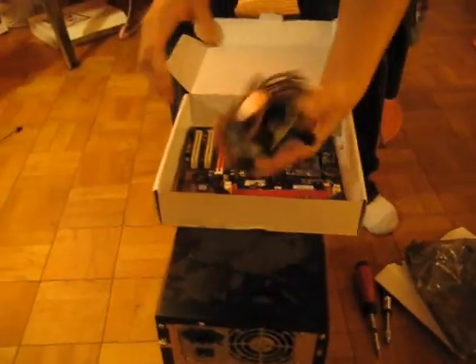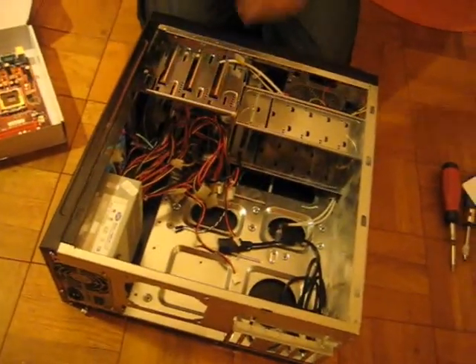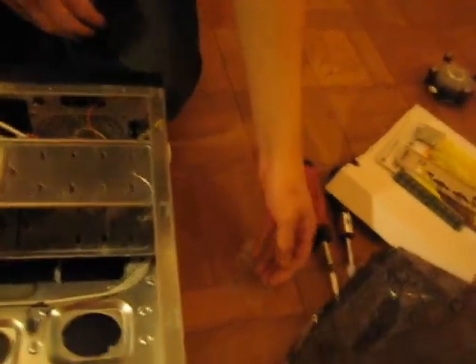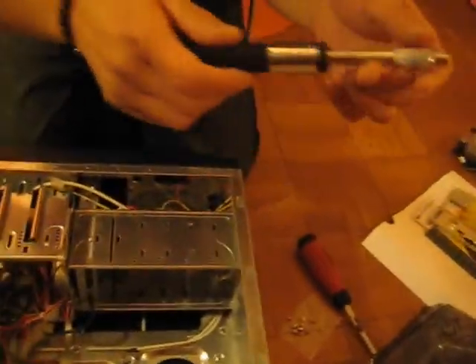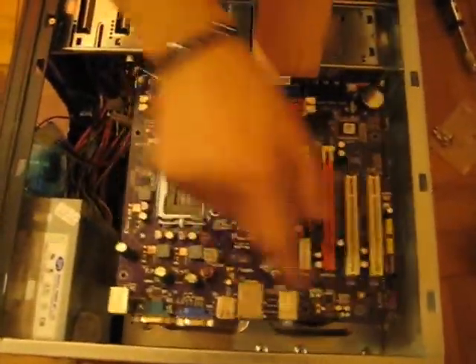Here's your motherboard and heat sink. What we're going to do today is put this motherboard into the case. Before we put in the motherboard, we need to put in the brass stands so the motherboard can stand up correctly. I have a little 5mm socket — you can use it for a screwdriver too, but I use it to make sure all the brass stands sit correctly.